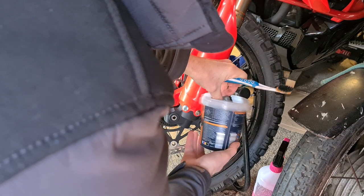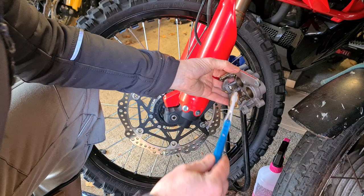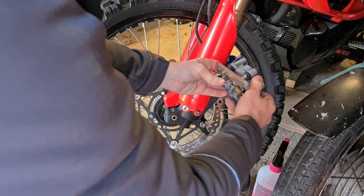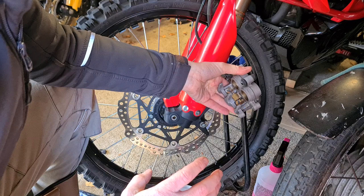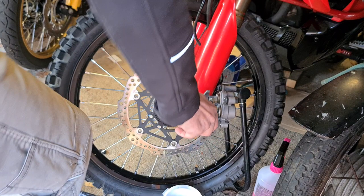With Muck Off and half a tub of warm water, get the caliper into the tub, give it a swish. Use a baking tray underneath or a bucket depending on the angle your bike's at, and get in there and clean it properly. Pop the little plate out at the bottom, make sure it went back in the right way. I've taken off these retainers - take them off again for the purposes of everyone being able to see. There's grease in there. Give it a right good clean - it's literally like new. It's very easy to get it back with a bit of soap and water, back down to very clean indeed.